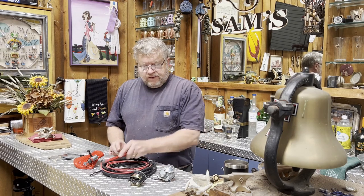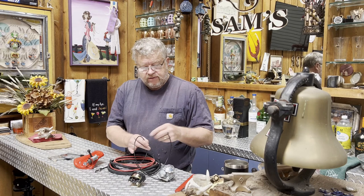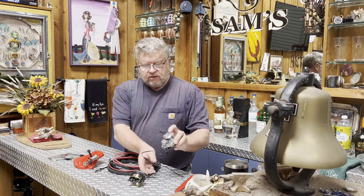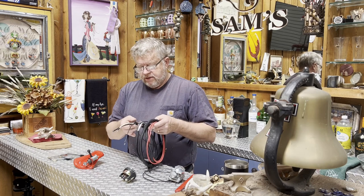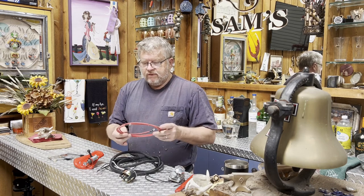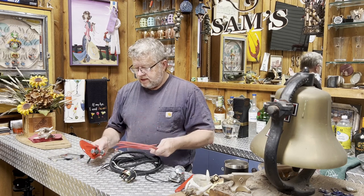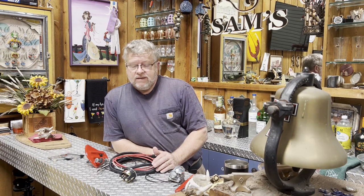So it took about maybe an hour to terminate all these pieces. We now have the rear light switch ready to go for the cluster switch. We got that all cleaned up and polished. We got the main harness that runs from the control cluster. Each end's terminated all the way down, splits out to that starter, and we have the main run switch here that terminates at the magneto. So all of that loomed up properly, looking nice. Took maybe an hour, maybe an hour and a half.